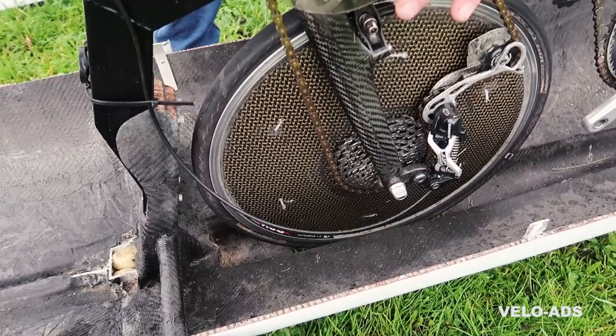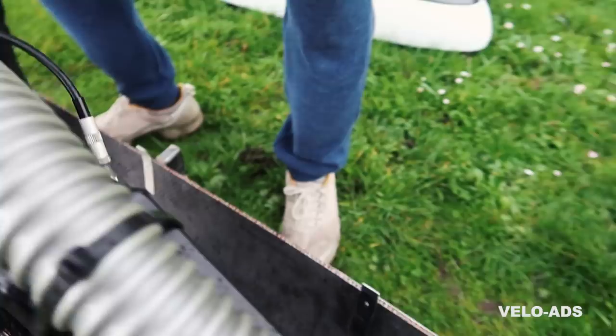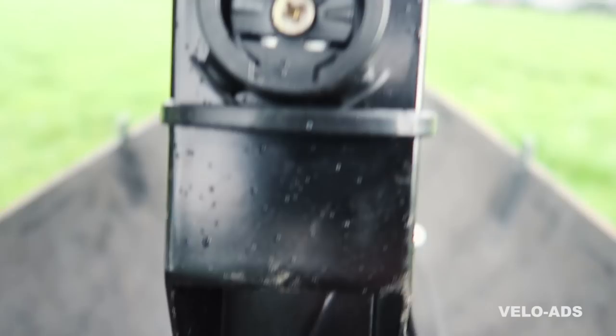That fork, beautiful workmanship. And there's the metal spine. It's just a metal spine that goes down the bike and gives it the strength. So basically you've got the frame, which you just undo the bolts here and two at the front. Then you can lift the whole lot out, which is really good for maintenance. And then the weight's transferred down through here, the strength to the back wheel. And the head lays on that, so literally there's no cushions. Your body just fits in the mould perfectly there.